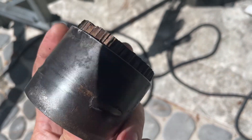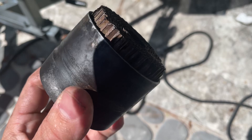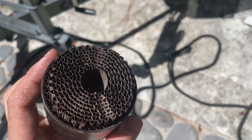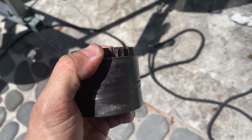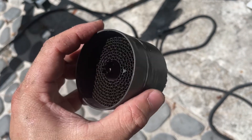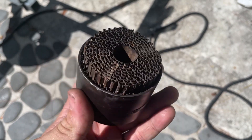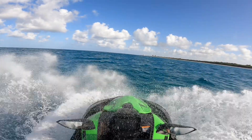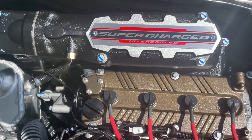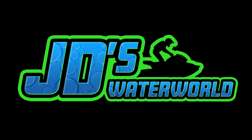Or inside of the head. So this does work well, but in that regard it is also a 50-hour wear item as Kawasaki states — it's no secret. In the manual it does say 50 hours, and my ski hit 50 hours and this was the first thing that I did. And I'm sure glad I did, because as you can see, this exhaust filter has failed.